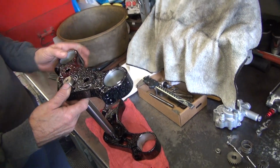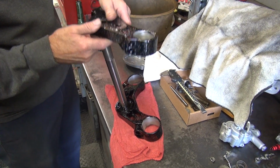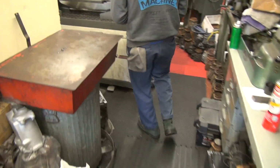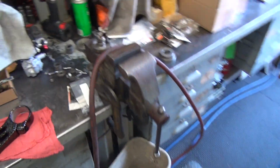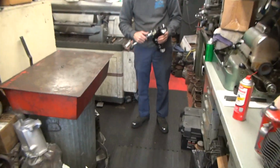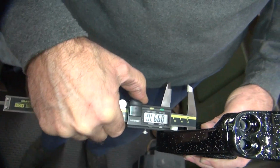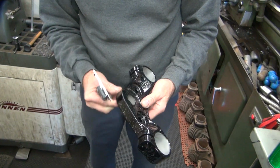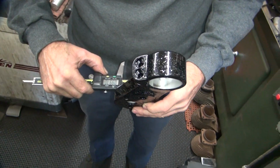Damn, look at that though. Does that fit on there too? Oh, that's good. So how precise of a hole did they make on this one? Very. What about this one? It's 97.5 on the powder coat. Off the powder coat, it's 97 also, which is the same size I had, but we already know 97 is press fit, so. Good enough. So this is measuring high spots. Calipers are not the most accurate thing in the world.